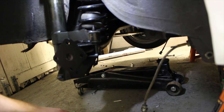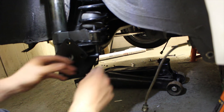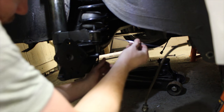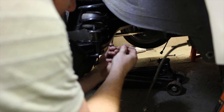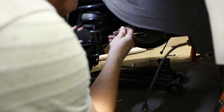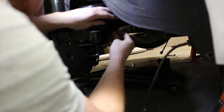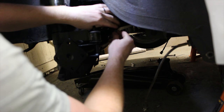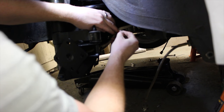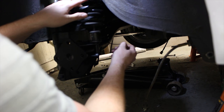Just putting back together all of the rear suspension with the new custom car bits. I usually cable tie my springs in just so that they see roughly where they need to be. I don't have to do this but I've always done it, just so it's easier reaching under and trying to locate the springs, because when they're this short they kind of drop about. When you jack up the car then drop it back down it doesn't always locate properly.